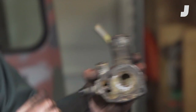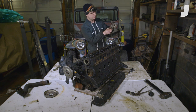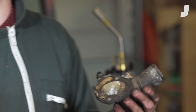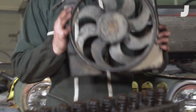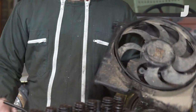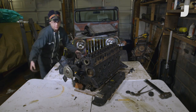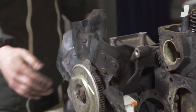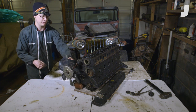What you can also see in this thermostat housing is a coolant temperature sensor called a thermistor. Its resistance drops with temperature, so your engine can use this voltage signal to make changes to things like fuel-to-air ratio and also to control cooling. Speaking of fans, the Jeep Cherokee has two different kinds of fans: an electrical fan, which is what most modern cars have, and also a mechanical fan, which is what you see in most older cars or commercial applications. This mechanical fan is driven by your serpentine belt on your accessory drive.